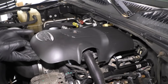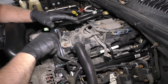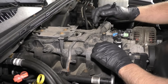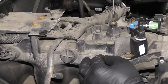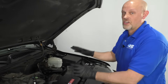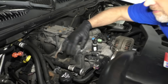Now let's get underneath the engine cover. Many vehicles have little covers over the engine and all you have to do is lift them up — some may have a screw. Look at the hoses connected to the intake and make sure nothing's disconnected, everything's attached. If you had some engine work done recently and there's a hose that's not connected, check any ports — if any ports seem like they're open, make sure it's not something that's plugged off. Something that's open should have a hose on it or a plug covering it. If you don't see anything visual, start the engine and stay away from any moving components, then try to listen for a whistle-type noise or air rushing, and feel around to see if you can plug something off if any of the pitches change.